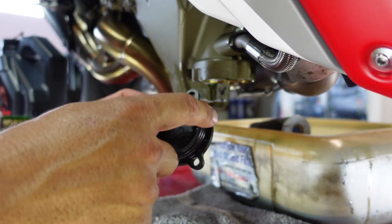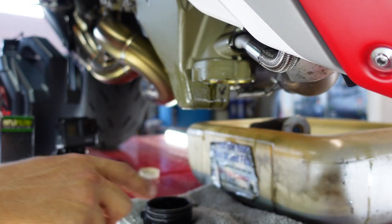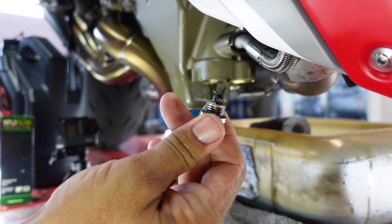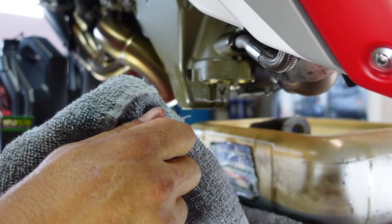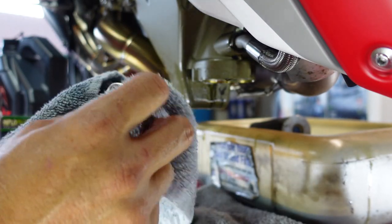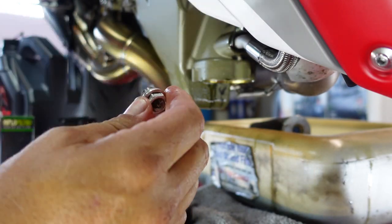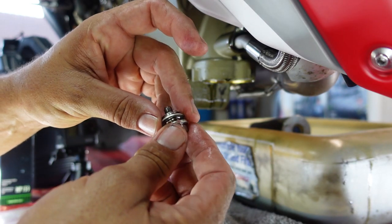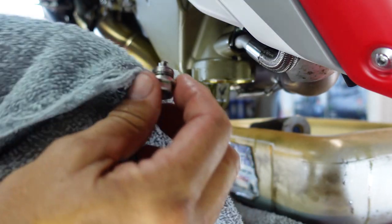Apologies — the camera battery died. We've got the new seal in here and the old ones off. Now we want to grab our drain plug and make sure we've got it nice and clean. Run cleaner through it, clean the magnetic piece off, get all the little metal pieces off, and make sure we take the crush washer off because we're going to put the new one on.